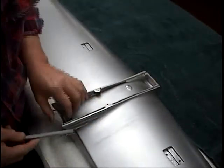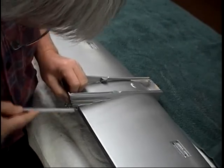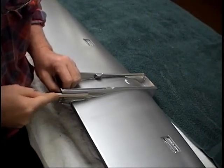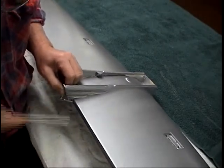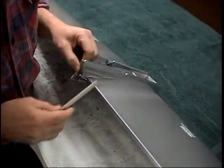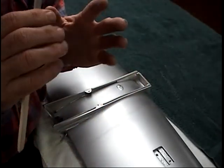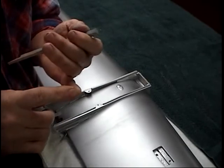Once that corner is done I can go to the square tool that has sandpaper stuck right to it, get right in that angle and edge. The wing I can sand out wet - that won't be a problem. Later in the week it's supposed to go to 40 and 50 degrees. I'd like to have some of these parts ready to put red paint on. As we close in on the silver, to me this is the most exciting time of building a plane - it really starts to look like a plane and every day it looks a little bit nicer. You can spend endless amounts of time on this and you do it to the level you're happy with. The only option you don't have is wanting a super high-quality concourse finish without putting in the time - there's almost a direct balance between the two.